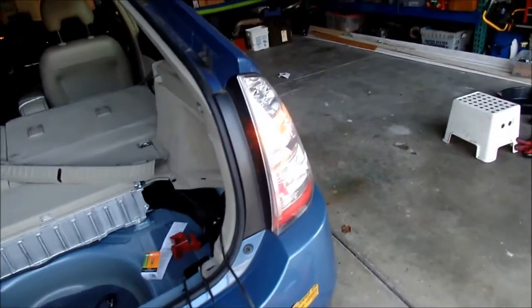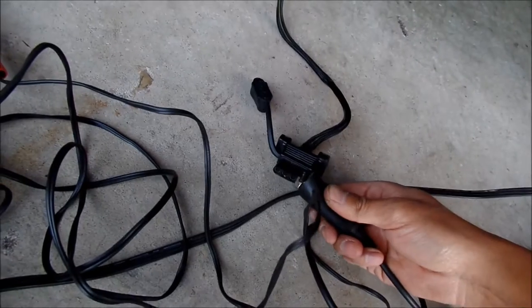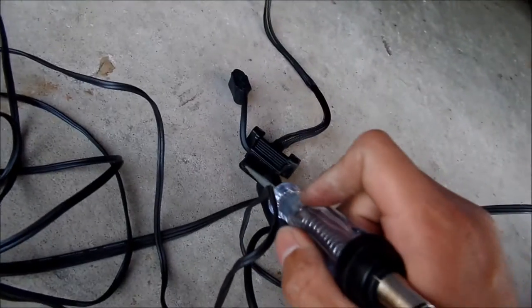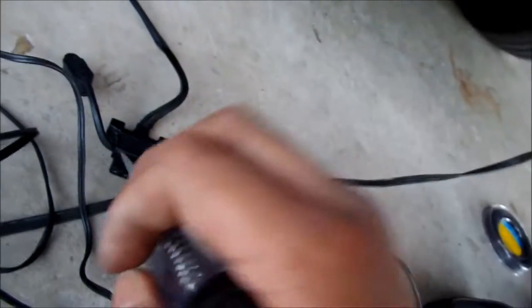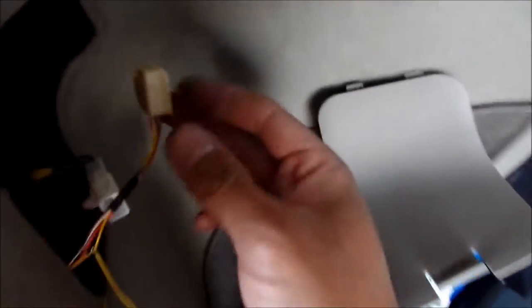There's the ground right here. There we go — that's the right turn signal. It works! I got a fast turn signal though — might have blown a bulb or something. Oh, I know why — the wire isn't actually hooked up yet, that's why the signal is fast. But it works.